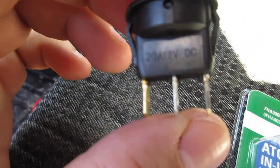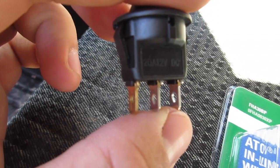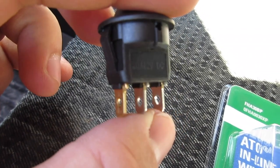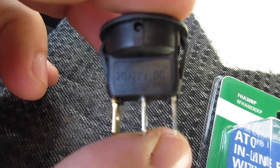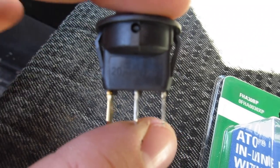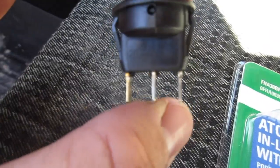If you look at the toggle switch, the negative is marked gold — it's a different color. And then you're going to see a 12 volt in the middle, and then DC. The negative is just going to be grounded off, or you can run it to the battery and put it on the negative there — it just needs to be grounded off somewhere. The 12 volt is going to run to the battery positive, and that's where you are going to tie in the inline fuse. And then the DC, the one on the end, is going to be a positive wire that runs directly to the lights, the light bar, or whatever you're doing.